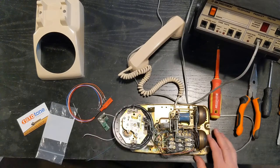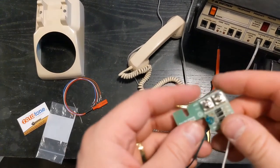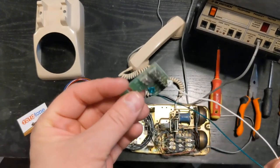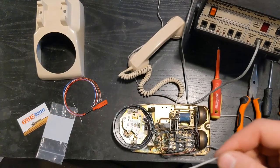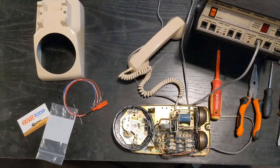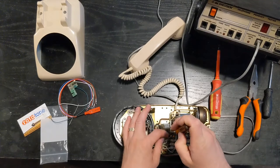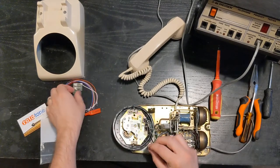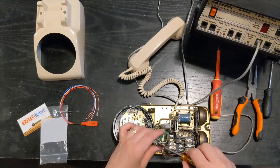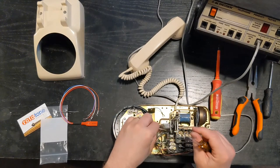The first thing I'll do is move the dial so it comes off nice and easy, and we're going to install our polarity converter. This basically prevents the phone from being plugged in backwards — if your tip and ring are reversed, this little guy here means we won't fry anything. So the first thing we're going to do is disconnect the wire from the C terminal. That should be a slate brown wire right here. We'll pull that off and connect it to the white terminal on our polarity guard, then take the white wire and connect it back up right where we disconnected the slate brown wire from on that C terminal.